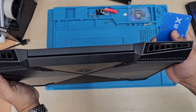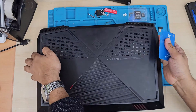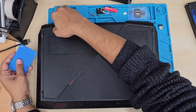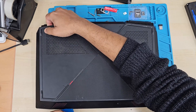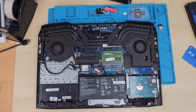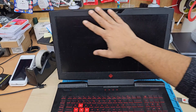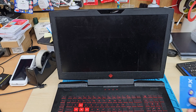Then you can plan it out and do that. To get the right part, sometimes when you search with the base model number of the product — for example, this is HP Omen 17-AN019 — if you search that way, it's always going to show as available but the price will be quite high. There is another way to reduce the price: pull out the old screen and check the model number printed on the back of the screen.